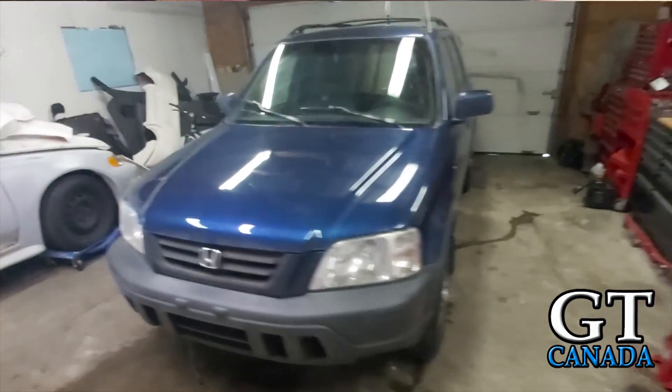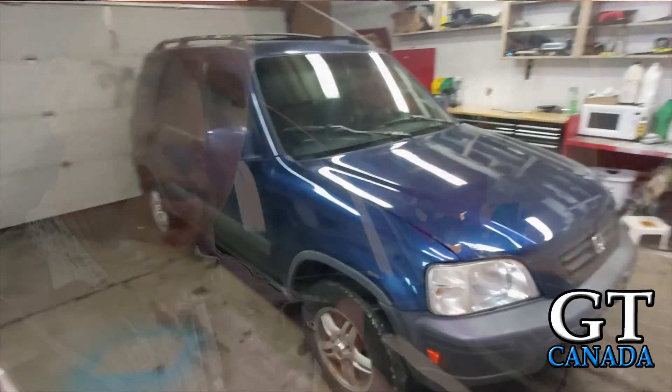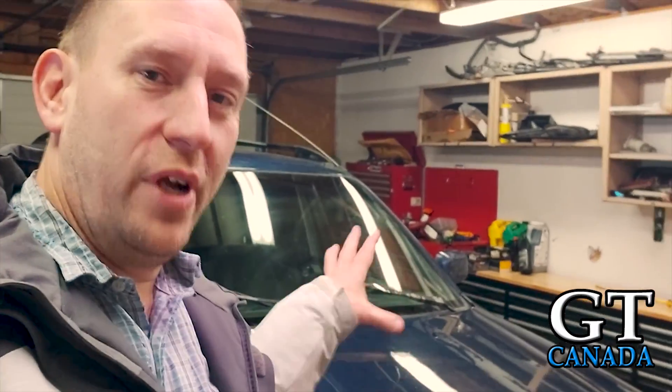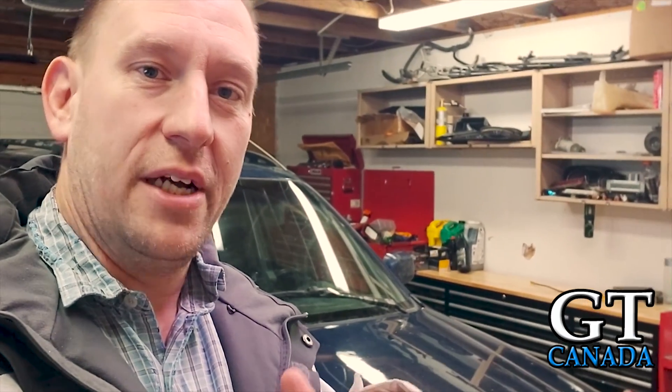You may remember if you watched some of my other videos, I talked about how my children live the $500 car challenge every day. This car was purchased two years ago for $500. It needed a front CV axle and a new lower ball joint — that's why the CV axle broke, because the ball joint split and broke the CV axle. It costed us less than $100 to get the parts at the wrecker. And this car has been running trouble free for two years, until last spring when his coolant hose split and dumped all his coolant everywhere. He drove it for at least a couple of days with no coolant in the car because he didn't realize why it was steaming and running kind of funny.